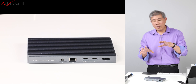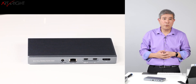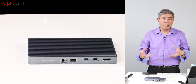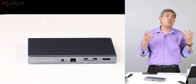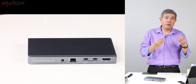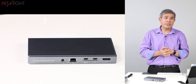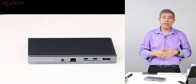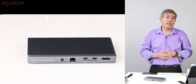I've tested this linking up to multiple displays using DisplayPort and Thunderbolt, and it works really well. One cable supplies signal to two displays. Note that you can't run two displays at 8K 60Hz simultaneously — if you link two displays up, it drops down to around 4K at 60Hz on both, which I still think is really good and is the de facto standard right now.